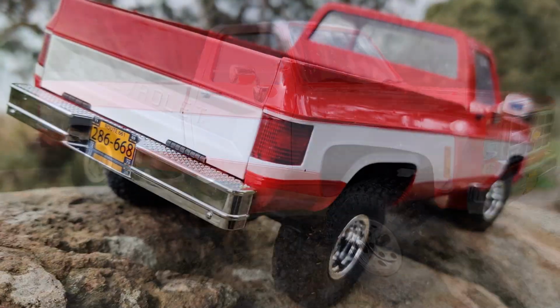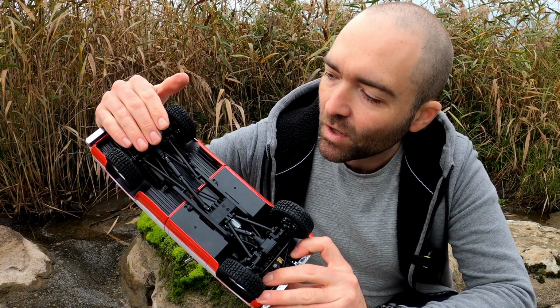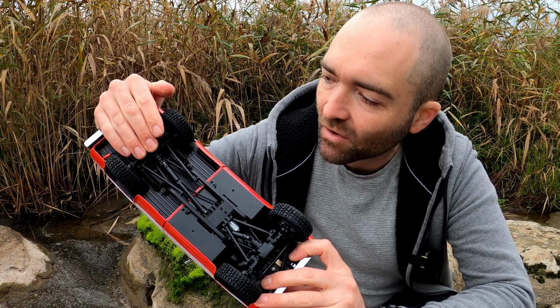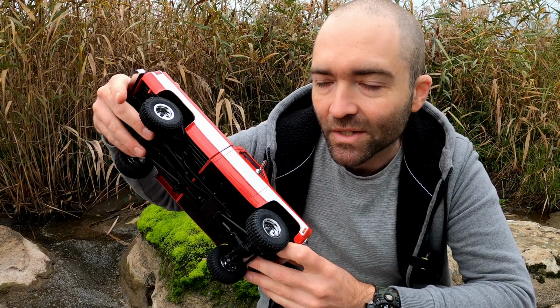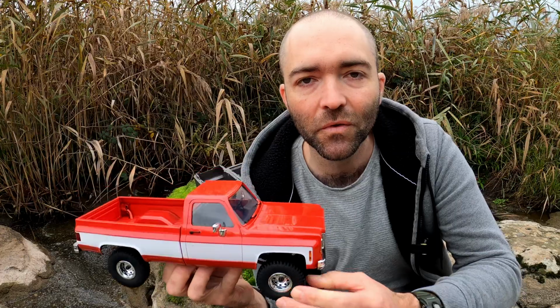The two things that jump out at me straight away as being maybe of questionable design. One, it's these laid down shocks, which work at first, but as soon as it starts to articulate, like you really get, it's very soft there. The stiffness decreases as they cycle up. So not good for carrying loads.